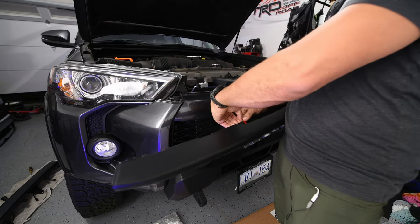The grommet fit is nice and tight where it was cut — no exhaust fumes or engine bay air seeping into the cab. In the engine bay, secure the wire by running it alongside the existing harness using zip ties, using existing holes in the structure as guides. Bundle and zip-strap the wires all the way to the front, keeping things tidy and clear of moving parts. The goal is to keep things clean enough that the bumper can still be removed easily by just undoing the tabs.